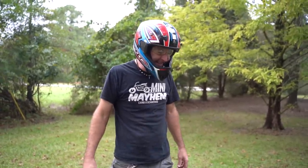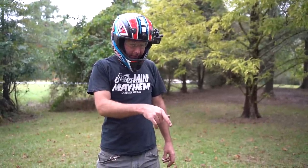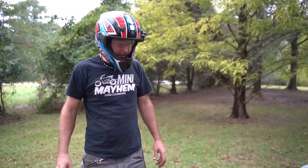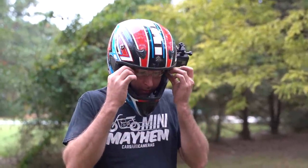At least we got to ride it. At least you got to ride it. Bummer. It feels pretty impressive. The vibrations are so bad. You see how bad that torque converter's wobbling. Yeah, at idle. It's terrible wide open. So, there's something wrong with that torque converter.